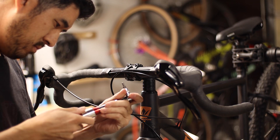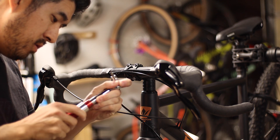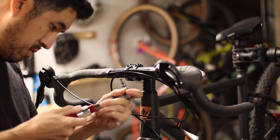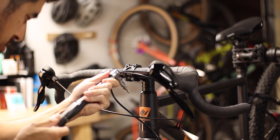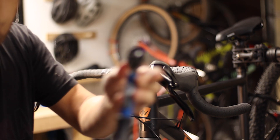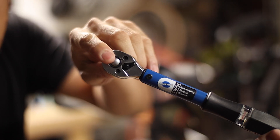One of the things I'm not super fond of is the scale. There is a scale for both inch pounds and newton meters, but neither one seems very intuitive and neither one has integer hash marks. Whereas my Park TW-5.2 has a clear viewing window and integer marks in a native newton meter scale, the Vanpo has rather odd intervals and it's never quite clear exactly what my torque setting is. For a bike-specific tool like this one claims to be, a native newton meter scale should be a prerequisite — not a huge deal though, and again for $40 US it's pretty hard to beat.